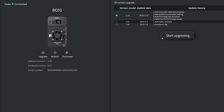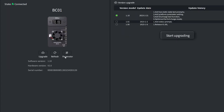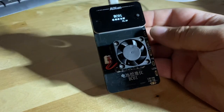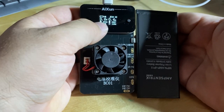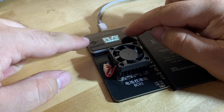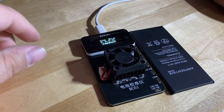Let's go ahead and upgrade the device and start the upgrading. There we go — successful. Here in the parameters is where you can view all the settings that you can alter. Adjusting these will definitely decrease the amount of time it takes for the cycles to actually take place. Now we'll come back over and plug in the battery. You can see now we've got battery at 4% and it still has all of the old percentage — 75%. So it automatically dropped down to 0% and then started a five-hour countdown. They have the recommended charge standing time at five hours, but I want to put it at two. So I'll go ahead and click download, and we'll come back after the two hours is up.